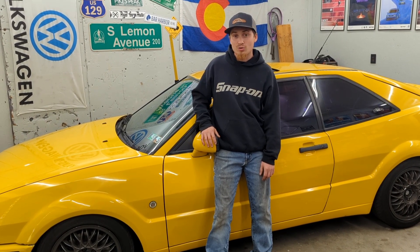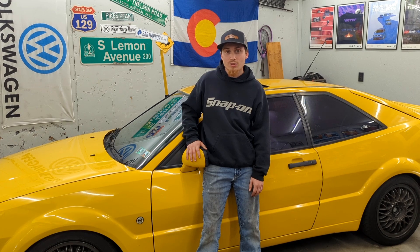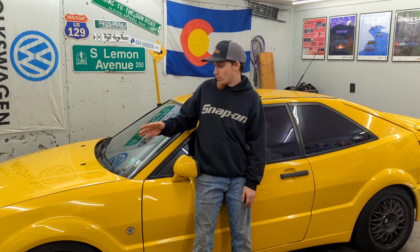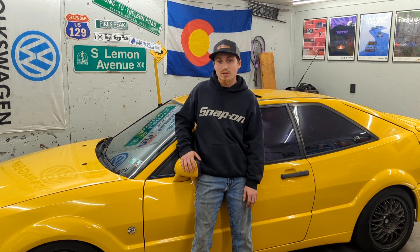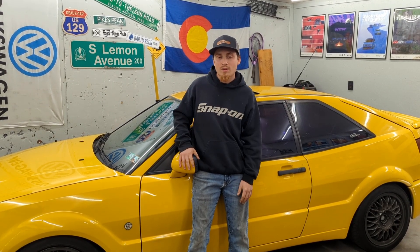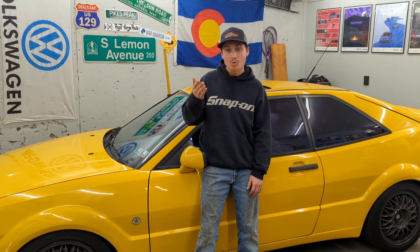A few things to mention for those of you trying to figure out your own ABS systems. The ABS light on the dash is a good indicator — when I started, the light never came on; once I found the blown fuse and replaced it, the light was stuck on all the time; once I fixed all the issues and cleared the codes, the light stays off. Also, the ABS control module down by the hood grab handle is a very common issue — they get moisture and the pins corrode. They're about $45-50, so if you're having issues it's worth replacing. We're still not communicating fully with VCDS — it lets me check and clear codes but that's it, possibly a mouse-chewed wire or bad module, but it's working so I'm not too worried. Thank you for watching — hit the thumbs up if you enjoyed, and we'll see you at the Tri-State Corrado Cruise!